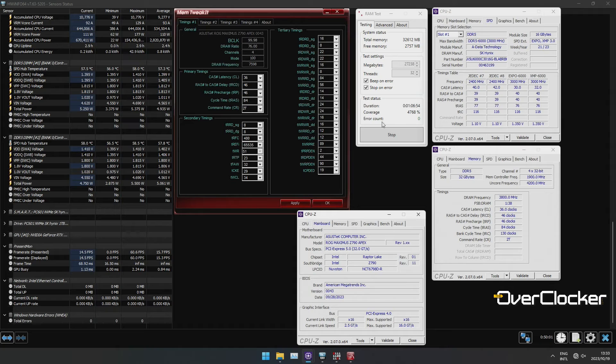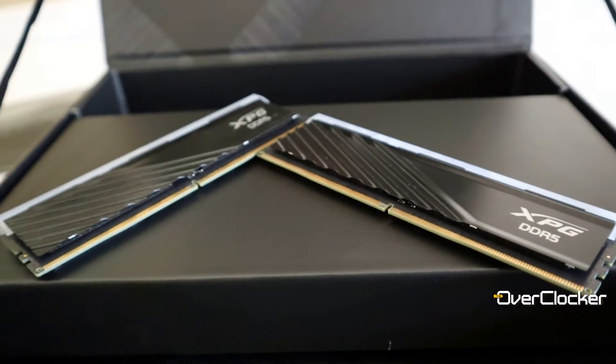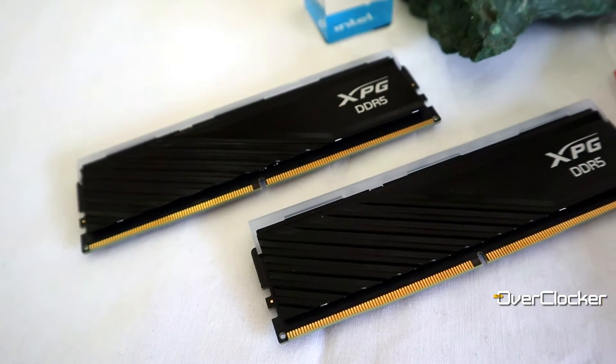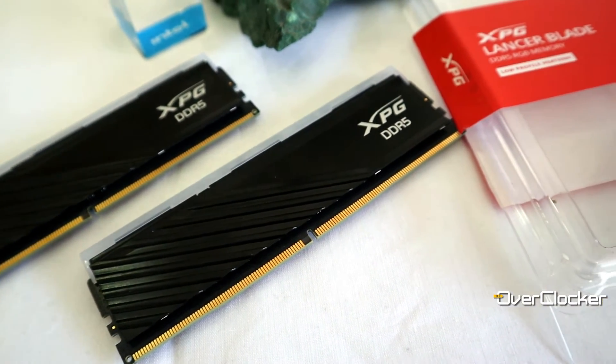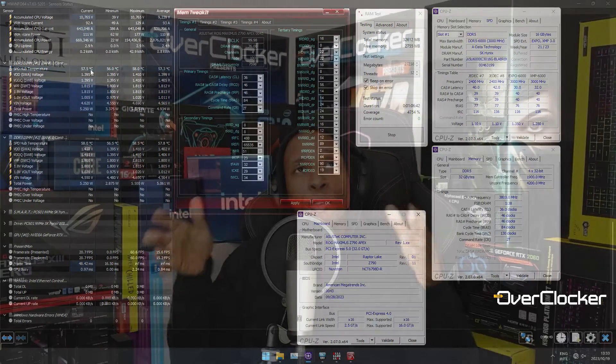So your effective limit for this memory is 1.4 volts, or DDR5 7600 — whichever way you want to balance that. Keep in mind that if you're paying around 2200 for memory that can do DDR5 7600, that's really awesome. It's like a gift and a curse at the same time — you're paying very little for memory that can do 7600, but you wish the heat sinks were a little bit better to tolerate the heat output.